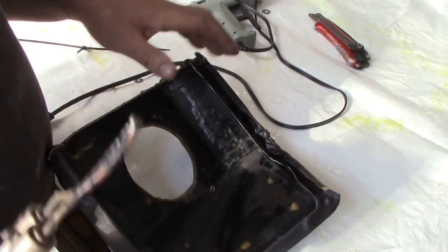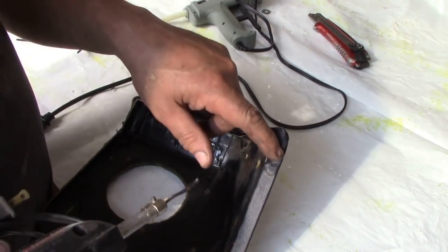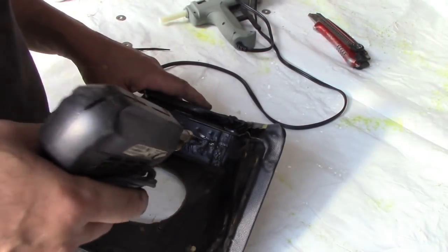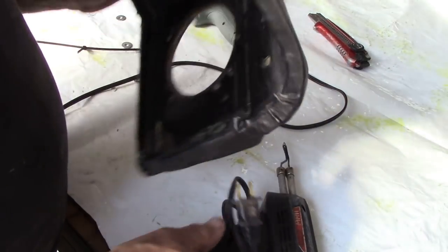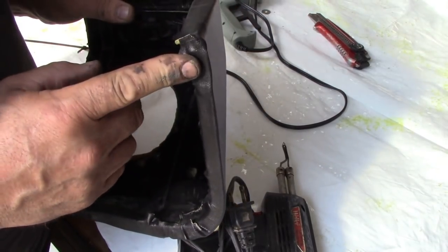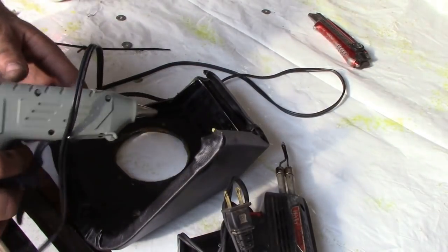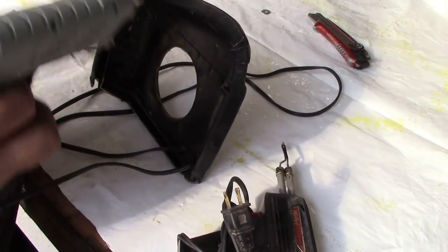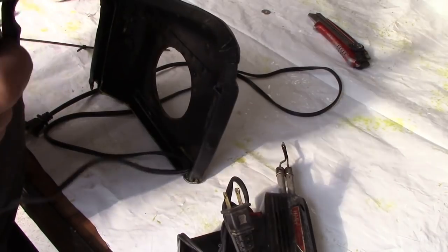We make the holes in the vinyl with a soldering iron. I know it sounds stupid, but you can't drill it because otherwise you'll tear it. So you've got to use a hot needle or something hot and poke a hole through where the screws go. And that's easy. But when you do this, just poke it through the first layer of vinyl that's been wrapped over. And then, using a hot glue gun, and make sure it's nice and hot, and don't burn your fingers, squirt some hot glue through, and push it down. That's if it doesn't stick.